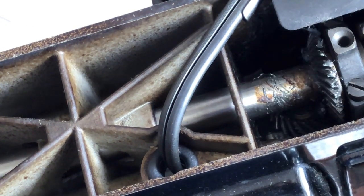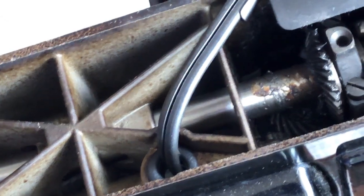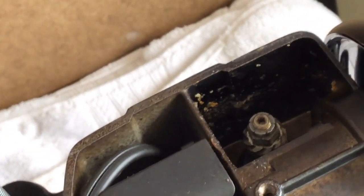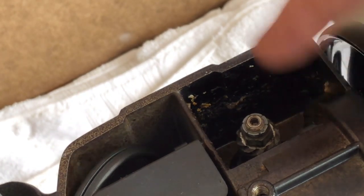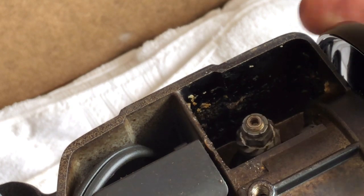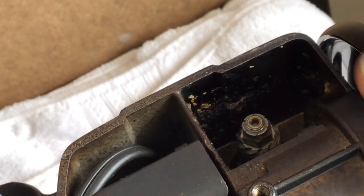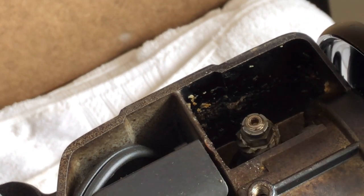That's essentially it — that is the gear. We've already greased the handwheel and the worm gear of the motor with Singer lubricant, and it's now spread onto the motor gear. If you have two gears that run together, you just get grease on one of them and it will apply to both. That's literally all I needed to do to grease the upper gear of the drive shaft.